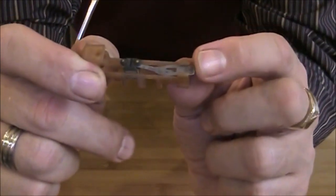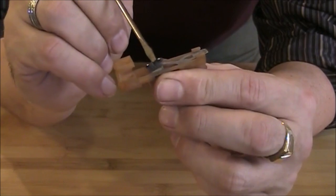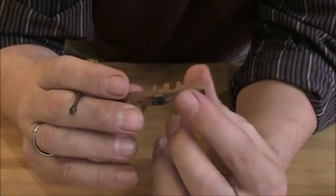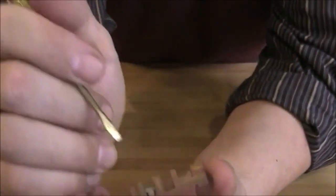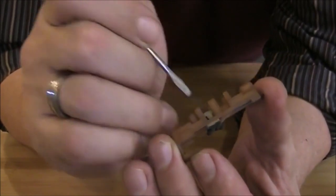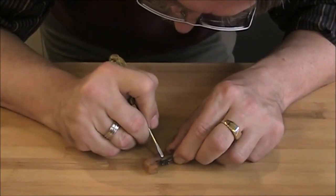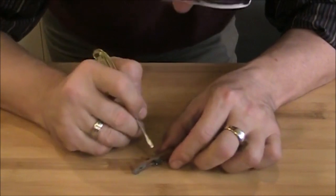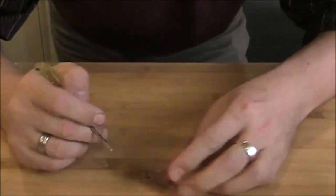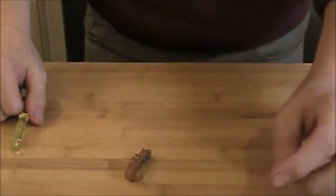So you see, this is this little leaf spring, and this is the shoe. So now to clean up, need to remove this little shoe out, and to pull it out you're gonna see that there are two little tabs over here that you need to push with a screwdriver, and this shoe is gonna come out. Just very careful. Just alternate, and you saw this shoe came out,